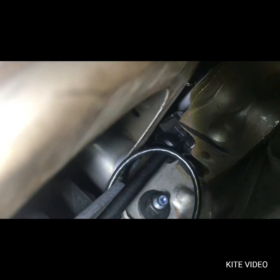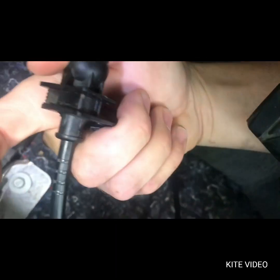After that, you're going to come right here. This thing snaps in right here in this groove, and there's just a piece of plastic that holds it on. You don't need a screwdriver. Take your hand, reach up behind this bar right here. There's a little thing on the back. You can take your finger and pry up on that little tab and pull out on it. And then you've got your bar off and out.